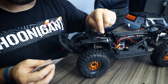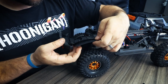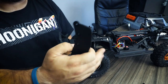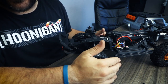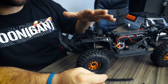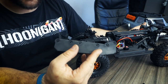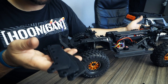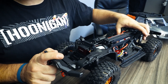The part 8081 wideners come with a drill bit to drill out pre-spotted post locations around the outside of the inner fender. After drilling, this piece goes to the inside of the fender and screws in through the inside at each of those spots with the included hardware. I don't run in a lot of mud where I'm super concerned about that gap, so I'm not going to install these personally. But if you run in a lot of wet conditions and want to maximize protection with inner fenders, this would be a nice piece to add. I'm also not keen on adding that extra weight to the top side of the chassis.